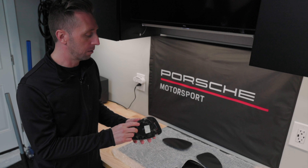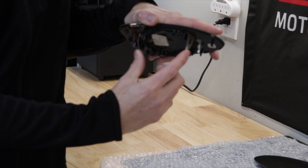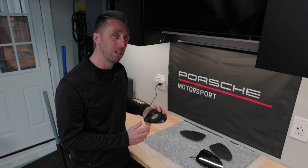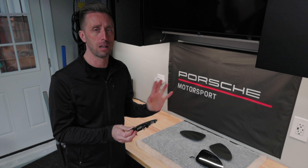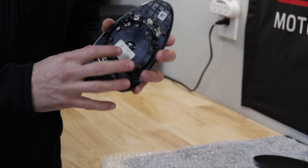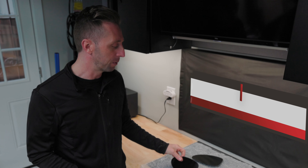The mirrors are held in pretty simply — a lot of cars are designed this way. There are little spring metal clips that just clip the mirror into the mirror housing. You need to pull with enough force to pop them out. It's a little scary because you feel like if you pull too hard you might flex the mirror and break it off. That's totally possible on other cars, but remember it's completely backed by a plastic area it's glued to, so there's a lot of reinforcement. Try to get your hand back there and pull with even force.